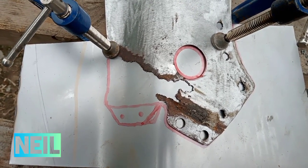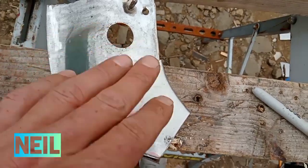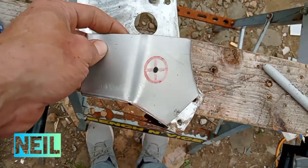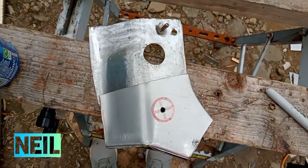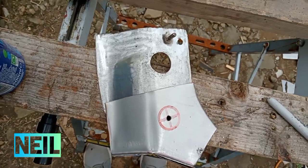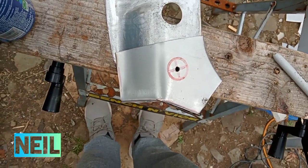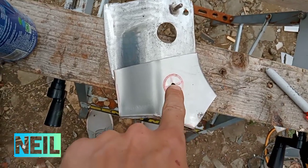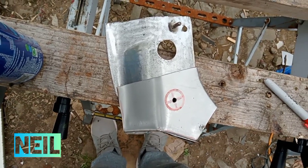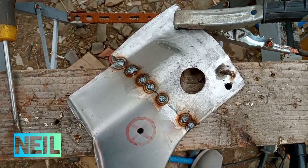That's my basic interpretation of what I'm going to have to do. So there's that bit made up. It's a case of marking it across here and cutting it. I think this is how this area is meant to go. When I put it into the van, it looks about right, so I'm quite happy with that. I'll drill this big hole later once it's in the van and I'll be able to get a better position. Plus it will give me a chance to get better drill bits. There it is tacked in there. I'll just go ahead and weld that in now.